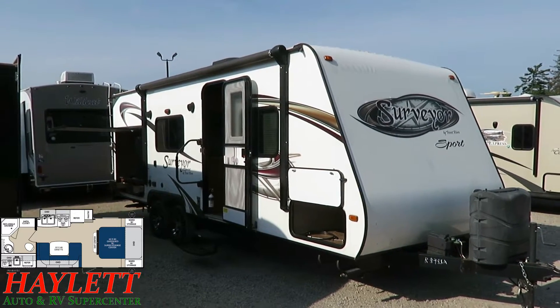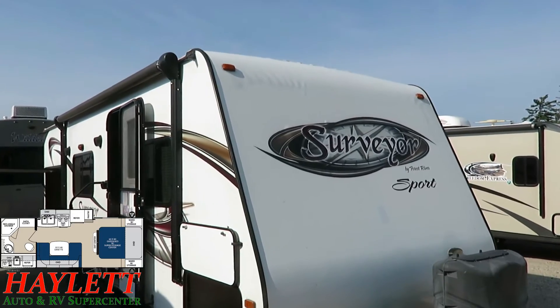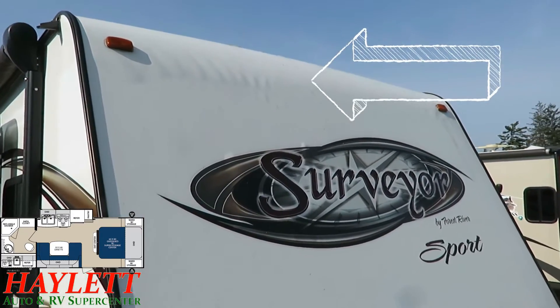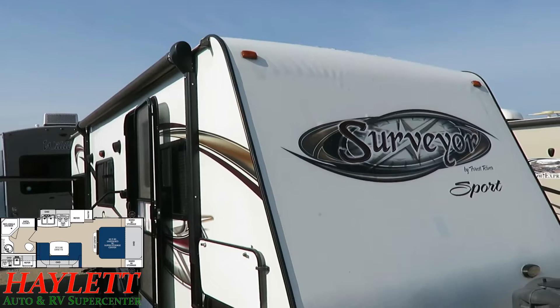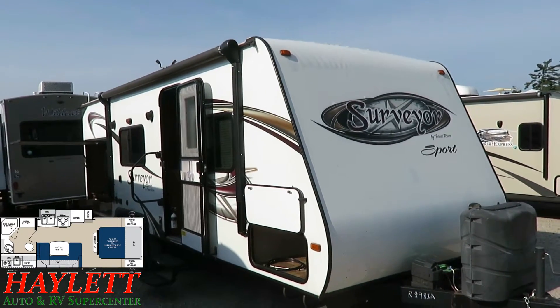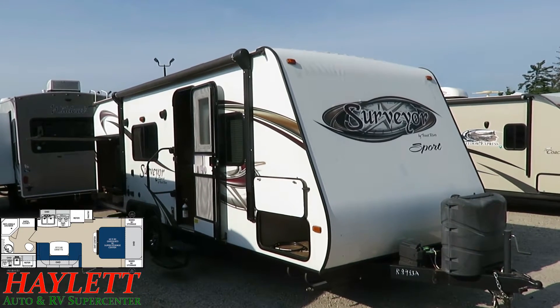So let's go ahead and get the elephant out of the room. If you look up here at the nose, primarily at the top area, but in a couple little spots, you can see a couple little wrinkles. This is what's called solar delamination. Basically, the sun kind of beat on the front wall of this a little bit harder than the rest of it where it was parked, and it causes the air and gases inside that laminated front wall to expand.